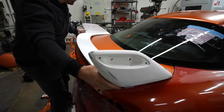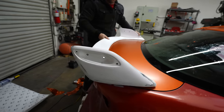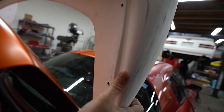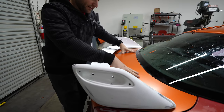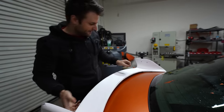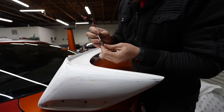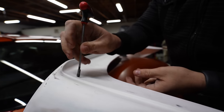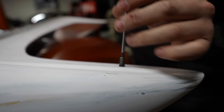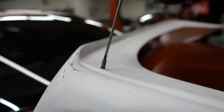Geo did the top part. We've got to figure out where to place this — it's meant for this car, and it actually looks better on this car than my car. There are tapped holes in it. Looks half threaded. So what we'll do, since we have the advantage of a markable surface, we'll just put studs in the bottom of all four corners, put it down, and then we've got four holes to drill through. I randomly have these studs — I think they're from Nodder's oil pan stud kit. I'll try to get them as low as possible.